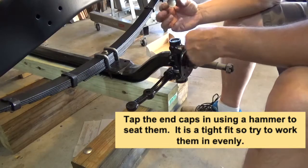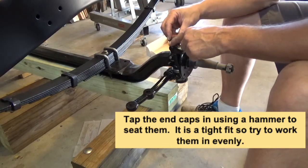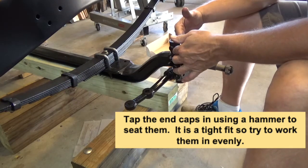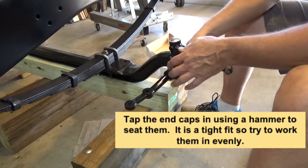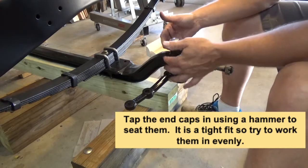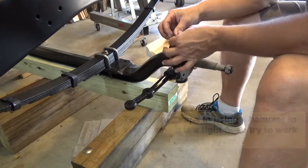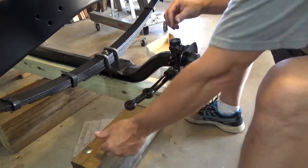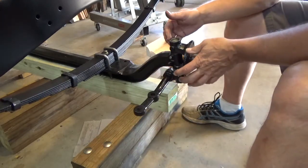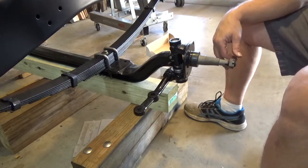The last thing you want to do is put these end caps on. They're there to protect the inside, keep dirt and water out as much as possible, and also to keep grease inside of the steering knuckle — because you do have two grease points here that you can use to keep them lubricated. Put these in and secure them, and that will complete the installation of the steering knuckle on your frame. Hopefully this will help somebody out there. Thank you very much, bye.